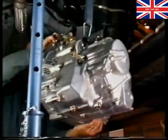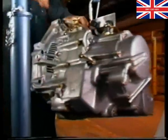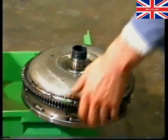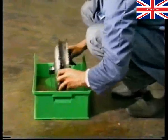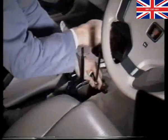Contact Network Services at Cowley. If they agree that a replacement gearbox is necessary, remove the gearbox and torque converter. Thoroughly flush the torque converter with new transmission fluid to remove contamination. When the replacement gearbox has been fitted, connect and adjust the selector cable — initial setting only for non-turnbuckle types — then fit the kickdown cable. Do not run the engine at this stage. There are two types of selector cable: the nut and olive type and the turnbuckle type. The two are not interchangeable. Please refer to the check procedure for cable identification.